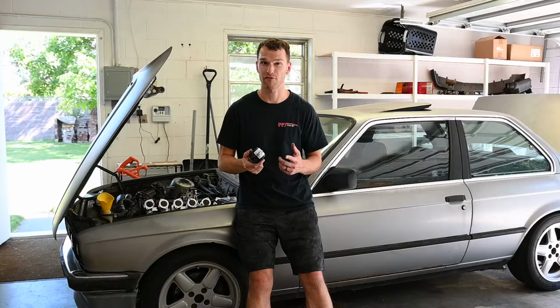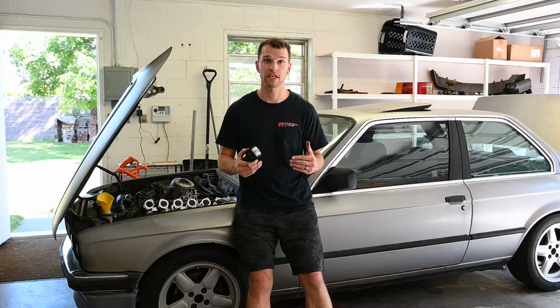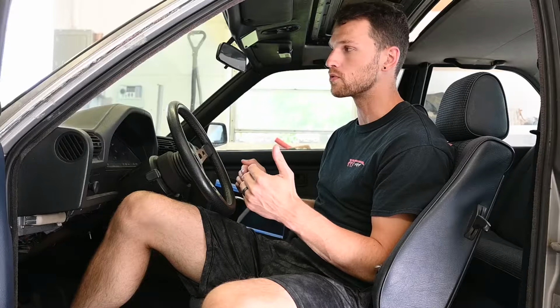So I think everything right now, just because of how much I did creep up the idle, it's probably pulling in a base amount of air to begin with. So we'll adjust off the middle, get rid of some of that extra airflow, and hopefully lower our number on our synchrometer. So at this point, I've got the ITBs even, pulling vacuum through all three pairs.